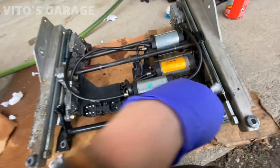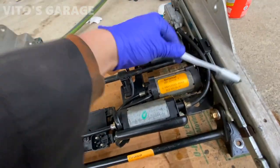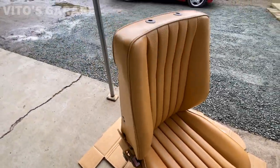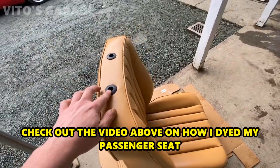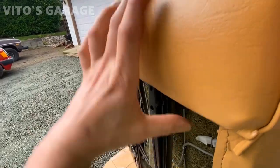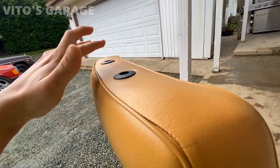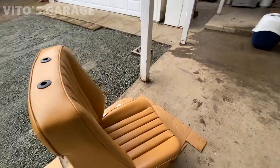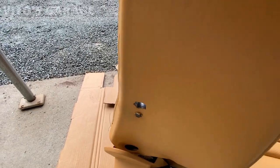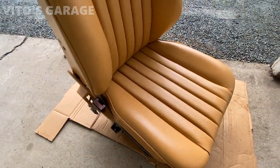Just cleaning this frame right here — all the tracks — from all the junk. Here's our seat, all restored and re-dyed. What I learned about these is they're actually really nice and firm now. You can go from underneath with a screwdriver — there's a plastic washer — put pressure on it and move that washer up, which tightens the clearance so they'll be firm. Since the armrest is going to go right here, I just had to cut out a couple of holes. All these plastics were painted and re-dyed and everything's been cleaned up really nicely.